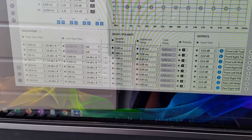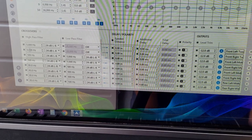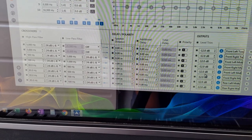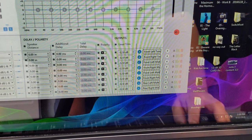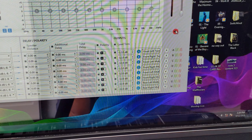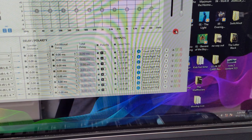If you go above 5,000 or 6,000 Hz it will cross both the tweeter and the mid-range if they're on the same channel, and it'll end up shutting down the mid-range driver — it did it to me. I had to double-check everything before proceeding. The reason it shows minus 12 dB is because I have the mute on, but if I change it, it'll go back to normal.